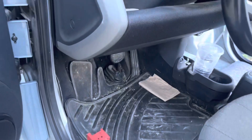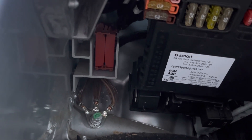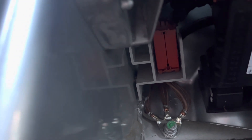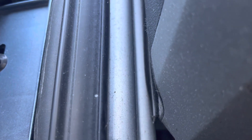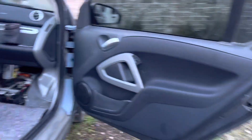First, get under here on the driver's side — you can see the fuse box right there. That orange thing has a little plug that you pull out. There's also another connector; somebody might know what it's for — put it in the comments. It's kind of weird because this thing just goes right over that. Anyway, pulling that disconnects the main power, which I think can be up to 400 volts — I thought it was 120, but it may say 400 volt max.